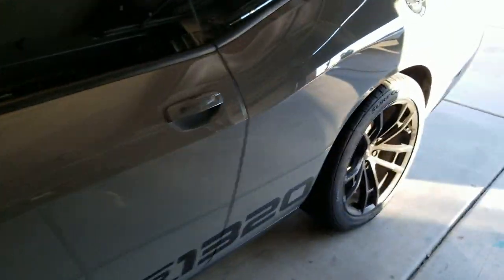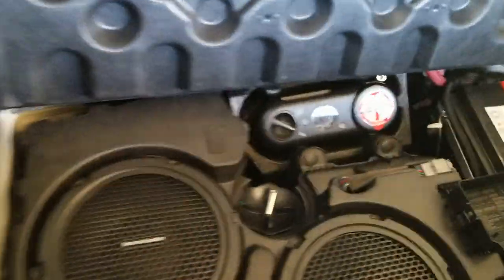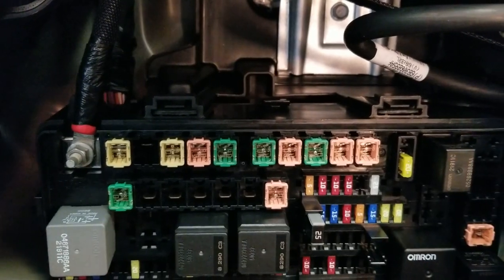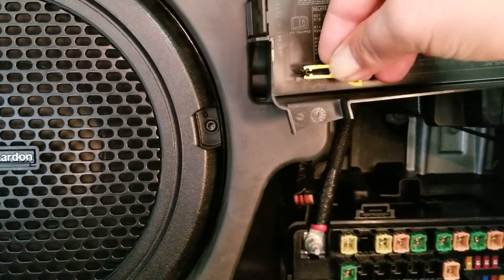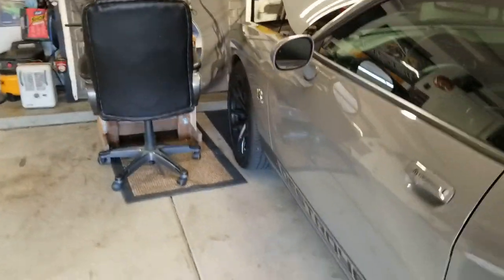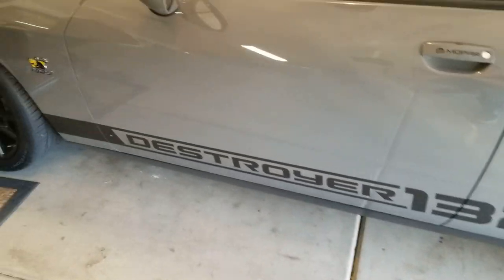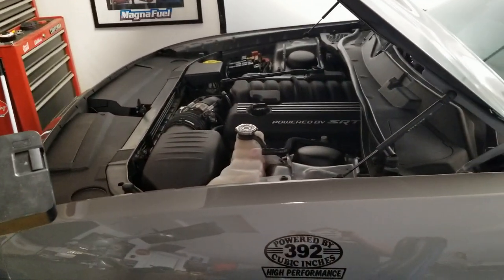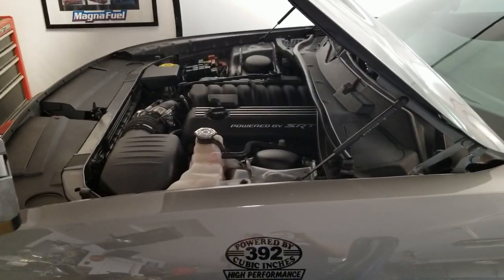But that was a pretty simple fix. The fuse that I pulled — that was the magic one just to get it back up and going. I know some people have had to replace their radios, but right there, pull it out for 20 seconds, pop it back in, and bingo, we're back in the game. If it keeps doing it I'll have to do the last thing on the planet I ever want to do and that's go to the dealer. But for today we got our screen back — no more burning my butt, no more making it too cold. Thanks for watching, guys. If it helps you at all, let me know in the comments, click like, subscribe, and I'll see you next time!